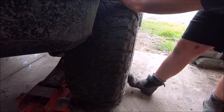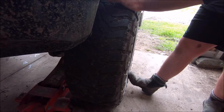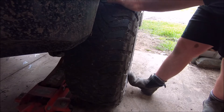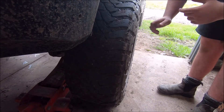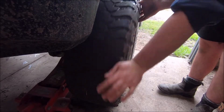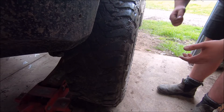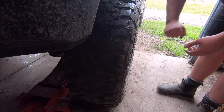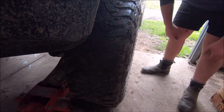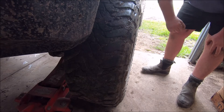By doing this, you'll feel the bearings loose — you'll feel it sort of jolt or a bit of a clunk. This one has only got a little bit of movement, so you might be able to see it on camera. There's a tiny bit of movement in there, and that's enough to make me want to just nip that nut up and make sure those bearings are tight. I'll also check if there's any water ingress in the bearing. That's the basic premise of how you check if the wheel bearing is loose — applies to all bearings on your car, truck, trailers, whatever's got a wheel bearing. You can also do it with a bar, put it in a hole of your rim and pry on it, and that'll also show you movement.